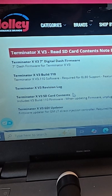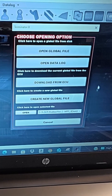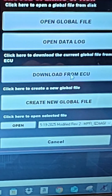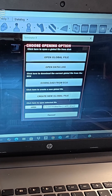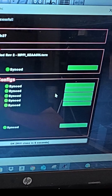Do not watch a guy like me making videos. Now that you've got your firmware and software updated, with the car on I'm going to download from the ECU. Basically I'm pulling the file that's on the computer in the car — I've been driving around on the base tune so the learn table should be updated. You can see it's downloading now, and now it's synced.